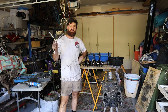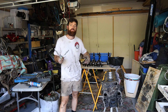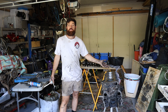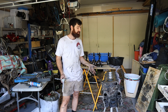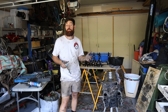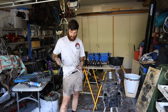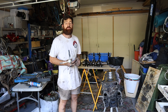That's it for this video. These things do have their place in the garage. Don't expect amazing results like what you would get from a machine shop. This will definitely restore the cross-hatching to your cylinder block, but it may not remove the imperfections — and in some cases, that might be all right. Your engine will still work. It won't be 100% perfect, but you'll definitely have good oiling, and for some cases that might be all you need to get yourself out of trouble. Now, these things can be dangerous — if you lift them too high while they're spinning, they'll spring out. I got my shirt tangled up in this and it came around and whipped me in the stomach, so I got a bit of a mark there. Learn from my mistakes — keep that in mind and just go easy with this stuff.